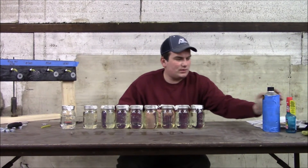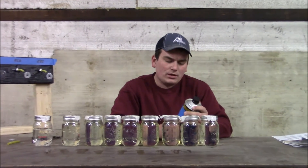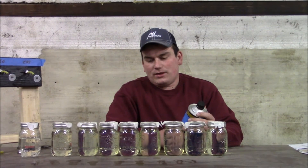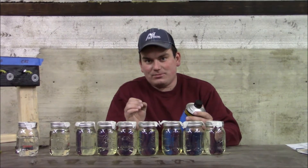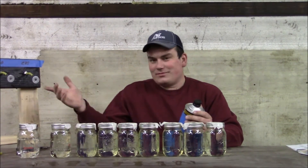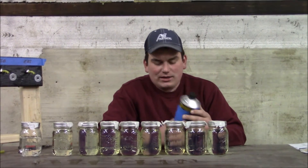A couple things I want to touch on. This is the $8.00 a quart fuel and I want to read a couple of claims it makes. It says: 'Street gasoline contains ethanol, which forms deposits and degrades fuel systems.' If you watched my first video, the E85 soaked fuel line was the cleanest and the non-oxy had the most varnish. I don't know what deposits they're talking about when they're blaming it on ethanol. They also say it degrades fuel systems — but their product was actually the worst. E85, E50, E30 all beat it. Flat out lying to you.